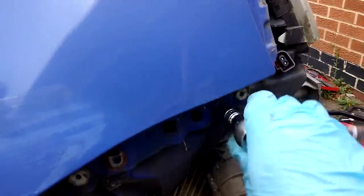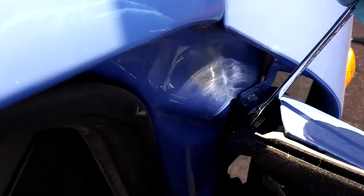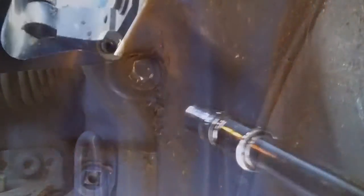Underneath that brace you've got two more bolts that need undoing — pop those to one side. You can spot there's a bit of rust, so depending on what you're doing you might want to have a quick look behind for a clean up. Now this bolt here is behind the door — it's a little bit awkward to get to, but luckily it just undoes and you can hand-thread it off. If your socket set's too big or your spanners aren't the right size, just get something on to crack it off and then take the rest off by hand. Then inside the wing we've got two more bolts — undo them with your socket. This is actually a nice simple straightforward job; it's just knowing where everything is and how to get to it.